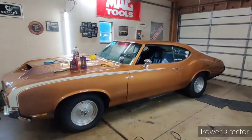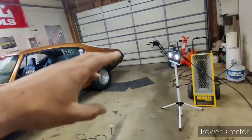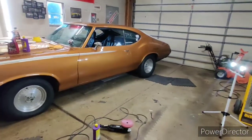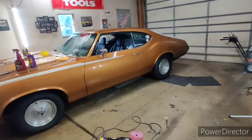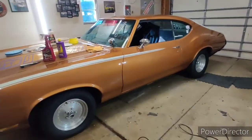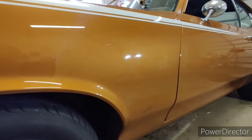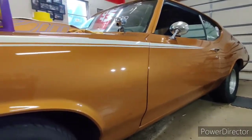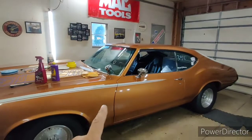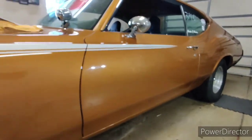For the use, this car is actually buffing out really nice. But a couple of things — I got the tower lights over here. These are LEDs. You really want halogens for this. It's just the way that the light reflects off of the car. The LEDs are white bright, but it's not the same as a halogen. I don't really appreciate it. There's like, right there, you can see some kind of minor scratches. This car really needs a cut with like some 3000 grit, but those are really fine scratches that you really won't see because it's a light color. If this was black, that would show up. And on this door I need to go over it again with compound — you can really see a lot more scratches, a lot more hazy marks.